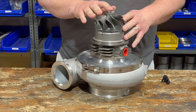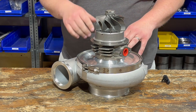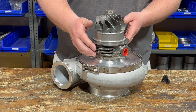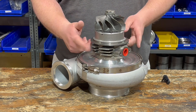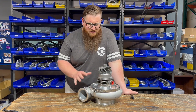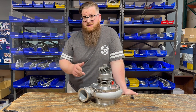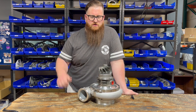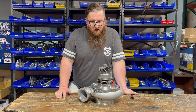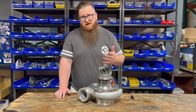As far as the turbine wheel, all the turbine wheels in the GTX turbos are going to be a 112 by 102. They all use this same turbine wheel, and I believe it is nine blades. You get a really nice bearing housing here, and of course this is dual ceramic ball bearing. You have fins on here for cooling — one of the easiest ways to tell with Garrett if it is a ball bearing turbo is to look for these fins. It's got a super nice billet back plate. As for exhaust housing options: they do a T6 and a V-band style. The T6 comes in a 1.24 and a 1.40 AR, and also a smaller 1.12, another 1.24, and another 1.40. It is important to note that all these housings are open flow — there are no divided housings available from Garrett.